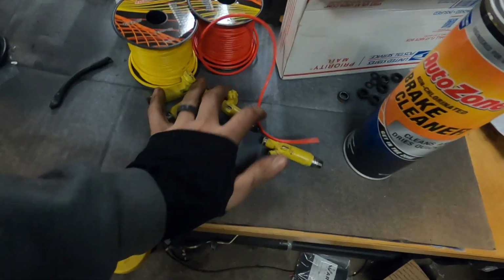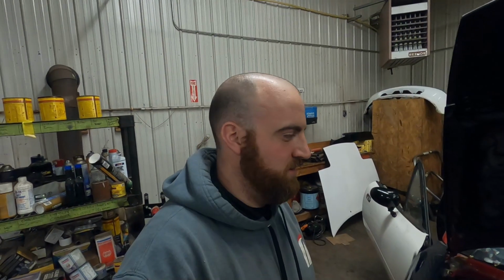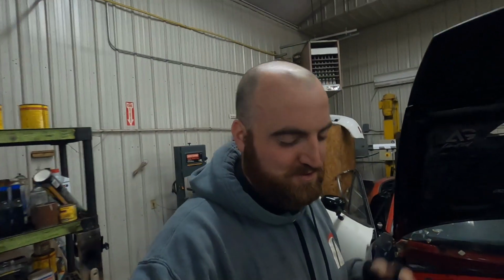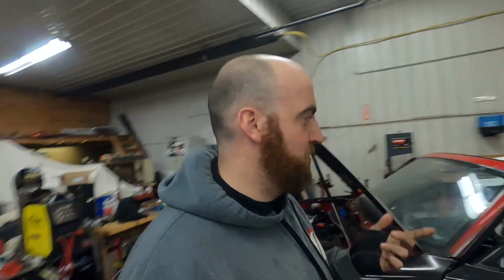We had RX-8 yellows, which are the cheap option for injectors, and they're really bad. They're not a good option. So we switched those out for some 1.6 injectors from our buddy Edgecomb down the street. Literally just yanked them out this morning. And then just to be sure, we switched the fuel pumps out. I just had a unit on the shelf.